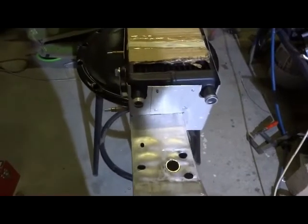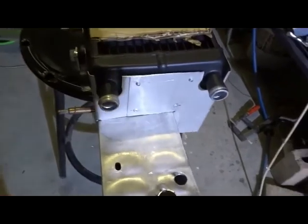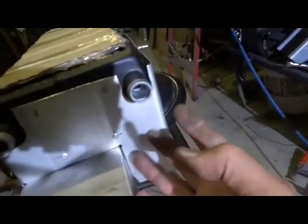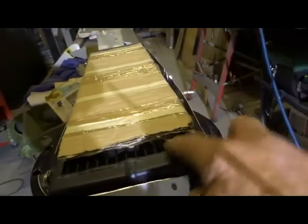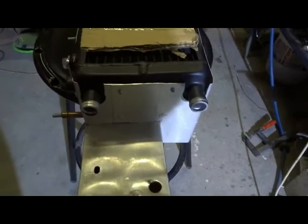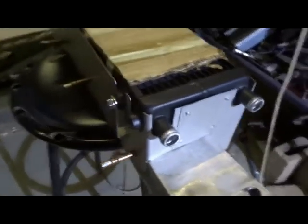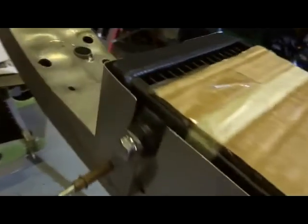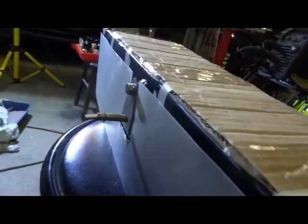Okay, this is the shroud setup, which is ducting the air into the radiator. The air is coming in the front and it'll have foam here, etc., and the air will be forced in through the radiator up and behind there. Cutouts for all the mounting brackets, and around there, and on the bottom just got one bracket and it's going to be held with a pop rivet. All across the top, just pop rivets. That should hold it, should be solid.